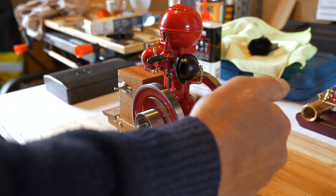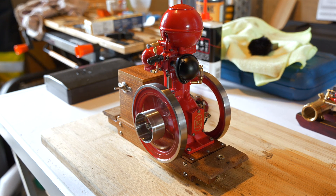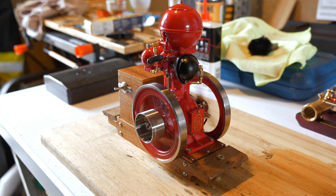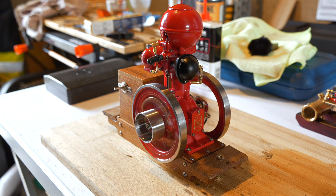On some engines you can change out the spring or put a lighter one on, but on this one there's actually a little nut you can adjust to slack off the spring a little bit. The speed she's running at now is probably near perfect, so I'm quite happy. I'll give her two or three more tankfuls of fuel at this speed before playing around with her. I'd really like to get that mixture dialed in perfectly, as she does rich up after a while — I think the high humidity is still causing it to run just slightly rich.